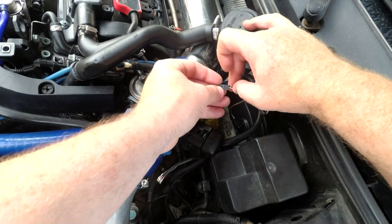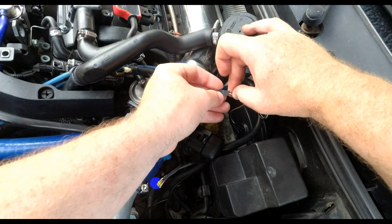Now I'm going to plan B — the pins don't want to stay in there. So at this point using the connectors is a no-go. What I'll do is hardwire it — hardwire the red, the white, and the black into the end of the pigtail that comes with the sender from AliExpress. I just strip the ends of the wire, twist them together, put some heat shrink over it, and that's it — job done. I was hoping to use the connectors but the pins are different so that wasn't possible.